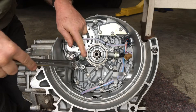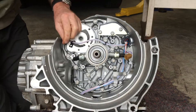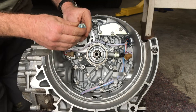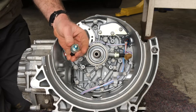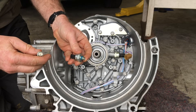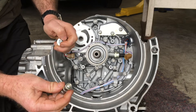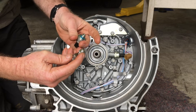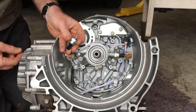To remove the pressure sensors, just use a 24mm spanner and they pop straight off. To reinstall them, I don't have a manual for these, but they are M10x1, which is exactly the same thread as the differential drain plug, and that's aluminium as well. So I'd use the same spec — 10 Nm — when I install these.